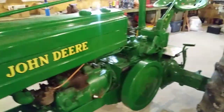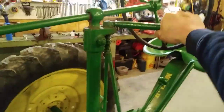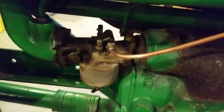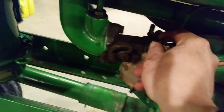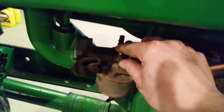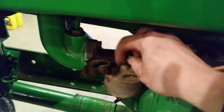We'll call that project a success. Let's try to check the water in this thing — yeah, I can see it. Let's see if we can kill it and see how low she'll go. I'll go all the way down with the throttle. We'll tweak that idle a little bit — this is the idle screw here. It's like two and a quarter turns out, which I think is a lot. We're going to run that in. There we go. That's a lot.